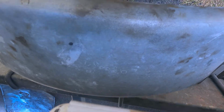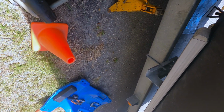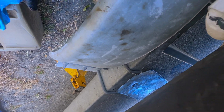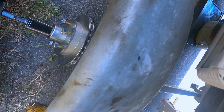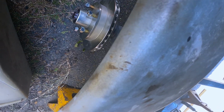Look at that grease and little dirt there that we're gonna clean off. I hate working outside. I think we got some dirt inside of this thing here. Let me clean this out some. But once you get this snug, you really have to back it off, because if it's too tight, you're gonna burn these bearings up. I got a dirt dauber or something running around me. So once you, that's it right there.